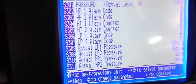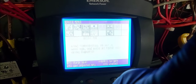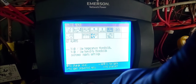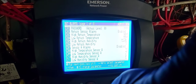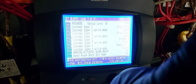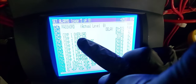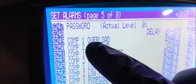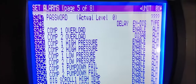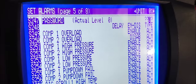I'm going to go back in and check the alarm setpoints, because I'm assuming that alarm has been disabled. Let's look for compressor number two overload in the alarm settings. Compressor one overload — enabled. Compressor number two overload — disabled. Let's see what happens when we go ahead and enable it. We're going to go into an alarm right away, and now we'll know why compressor number two is not running. Let's re-enable that.